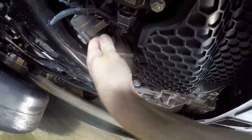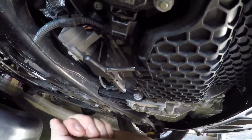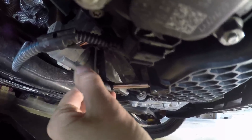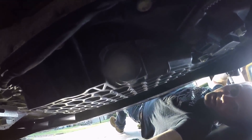On the drain plug tool: it stops 100% and clicks into place — do not keep going after that. It doesn't feel like a traditional bolt where you torque it to 13-14 foot-pounds. It just turns, you feel a notch, it clicks into place and that's it. It looks like the handle ends up horizontal when done — maybe one full turn and it just clicks. Then you're ready to start filling with oil.